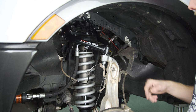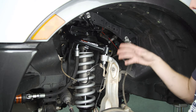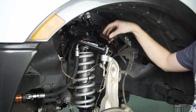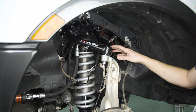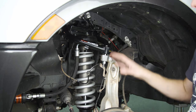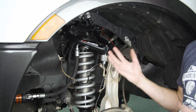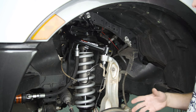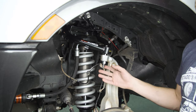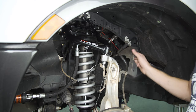From here it's pretty simple — we're going to put the splash guard back up into place, reattach the ABS lines, and if you got the separate billet caps to protect the top of the uniball, pop those on as well — they just use a little 3M adhesive. One last thing to know: every bolt we've touched here needs to be torqued back to factory spec. It's worth hitting that with a torque wrench at the end to double-check everything is tight.